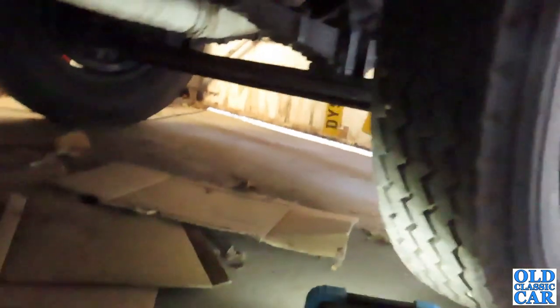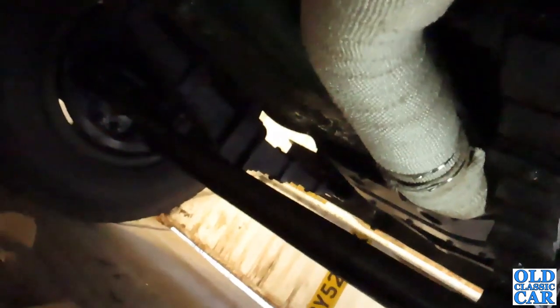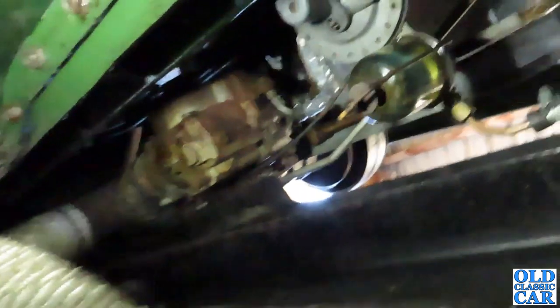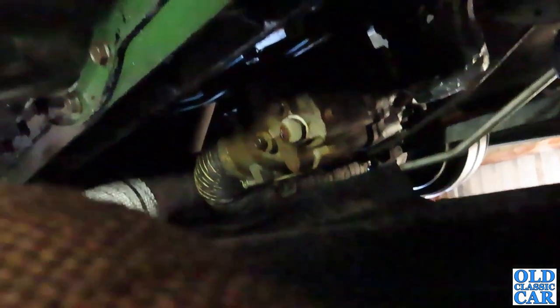I'll just slide under here. One good thing about lorries is you don't have to jack them up — you can just clamber underneath. You can see the exhaust is lagged with special exhaust wrap for most of its length, though there's a little bit that isn't. It was cooking the batteries, which is never great. Going under here you can see the exhaust, the bottom of the fuel pump, and the bottom of the carburettor. Along the chassis there are three convenient unused holes, so I'm going to make a heat shield that comes over from the chassis and around to deflect heat from the exhaust.